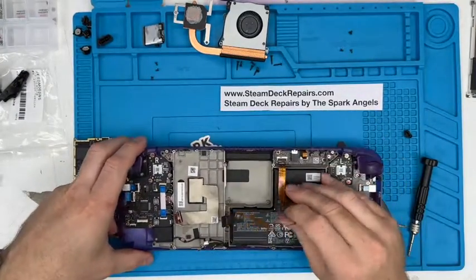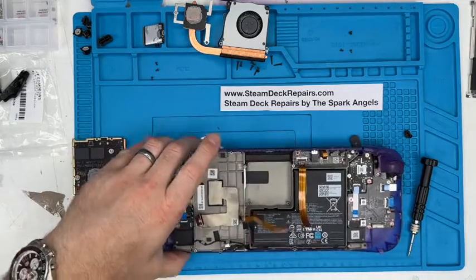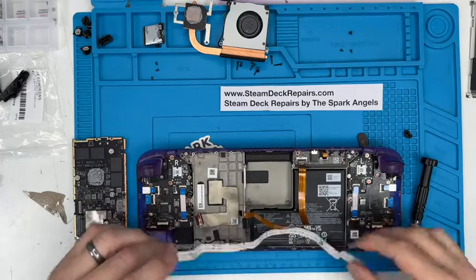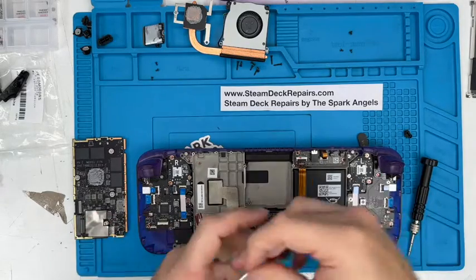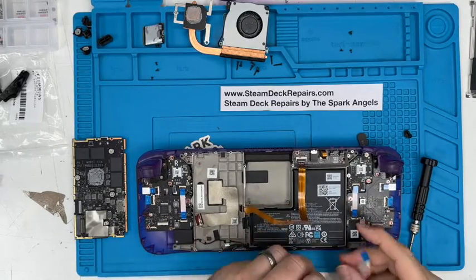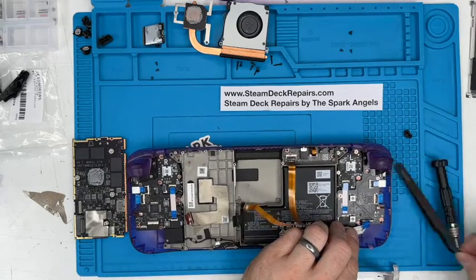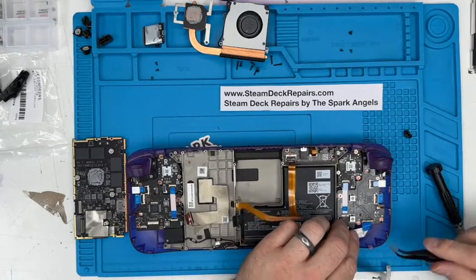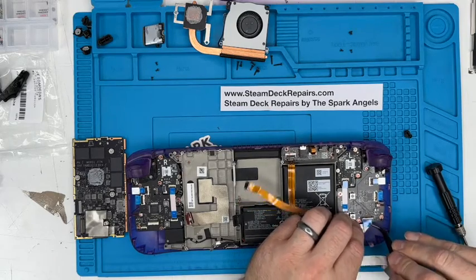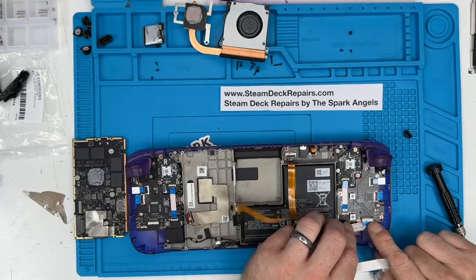Then we run the audio cable. Now, which went first? Let's have a look. We've got this big daughter board cable that goes in, and that's going to go all the way across and underneath the main board. So first we'll start off by putting it into this clasp. So we'll flip that clasp up. Put it in place. Again, it's like the others, it goes in at a slight angle in the middle. Clip that down, check that that line's where it is.